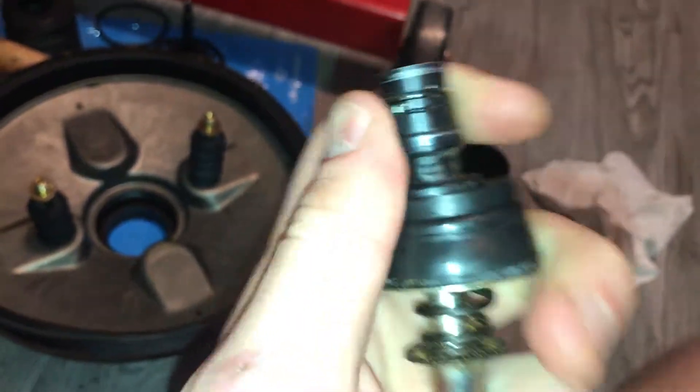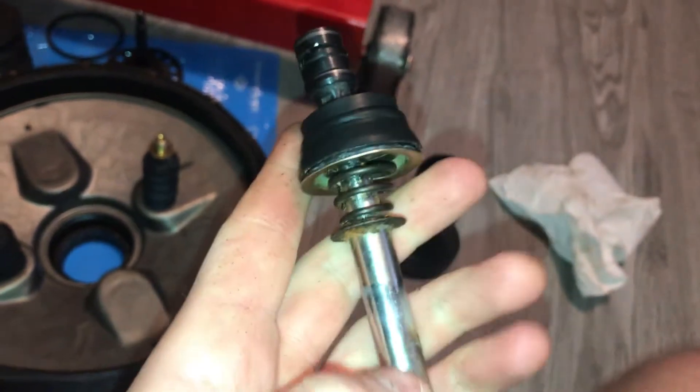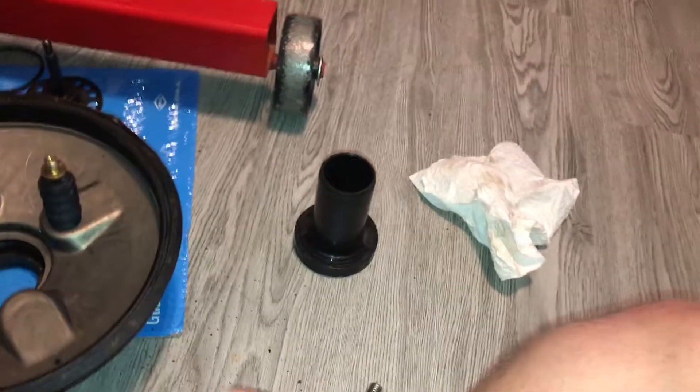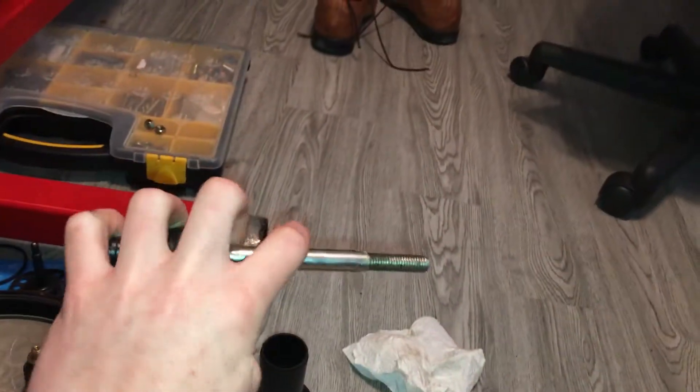As you push the pedal forward, this seal would stay still and the rod would move forward along with this little rubber seal part up here. I also didn't pick up on this, but this little head can actually swivel. There are some swage or crimp marks there, and it looks like there's probably a ball and socket sort of thing here — just so that when you have this mounted in your car, this can move with your pedal while this remains fixed. It's circlipped in here, so a little bit of mobility.